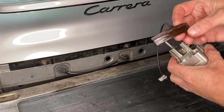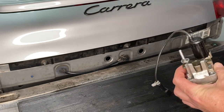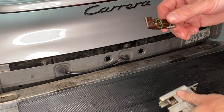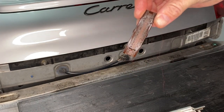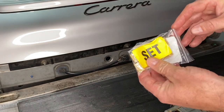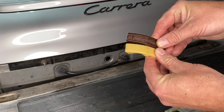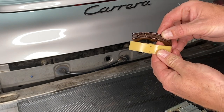You can see that the upper cam pad is pretty well worn. Popping off the lower cam pad now - that's the one that has the green O-ring. Never mind the crazy hair in the garage - look at the crazy damage to the cam pad. Here are the new ones from Pelican Parts. They look much nicer and are a different colour. My understanding is that the new ones are a different material or a different design to the ones that came originally on the cars.